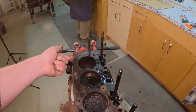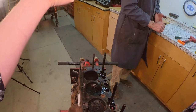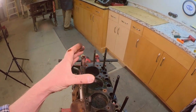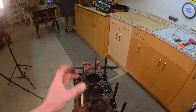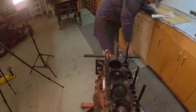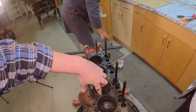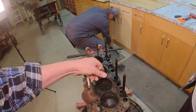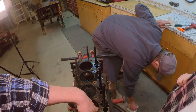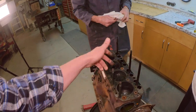When we pull the pistons, you'll see the top ring. The ridge is at the point where the top ring stops when the piston comes up and then goes back down. The ridge indicates wear in the bore. The bore has gotten bigger from the rings and piston going up and down, and you can feel the ridge with your fingernail at the top where the ring stops every time it returns. Some of it's carbon, from being fouled up. The plugs that came out of this thing were ugly. That's completely burnt fuel, and if this thing has any blow-by, engine oil vapor from the crankcase gets burned and turns into that schmoo.